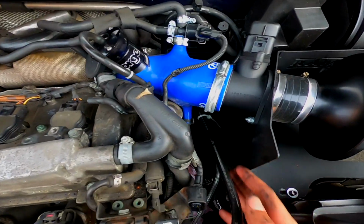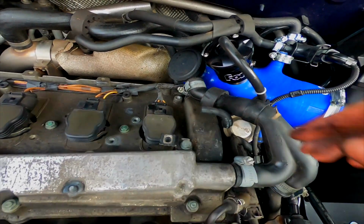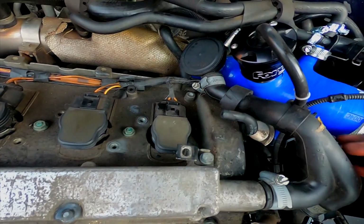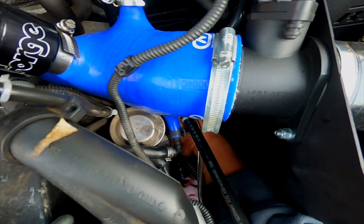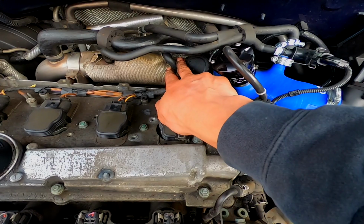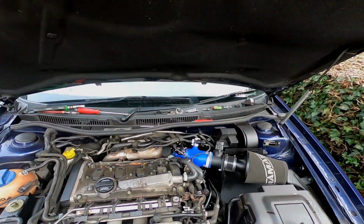Okay guys, so as I have a feel around on this combi valve and look back at the guide, it does say that there is another vacuum line which goes to the turbo inlet pipe. That is this one here. It is right at the back. It comes off the combi valve rigid. You may be able to see where my finger is. There is a hard line here. So I'm also just going to cut that while I'm here and then see what the next things are.